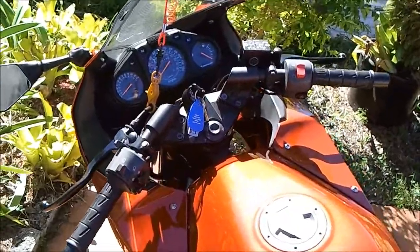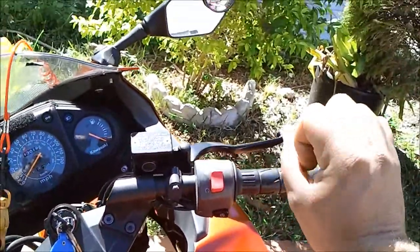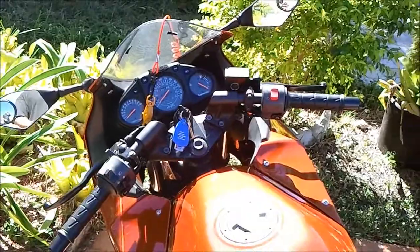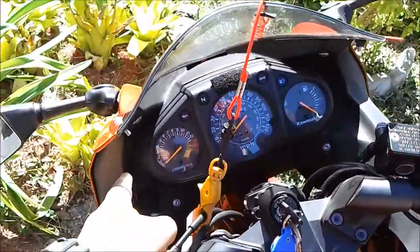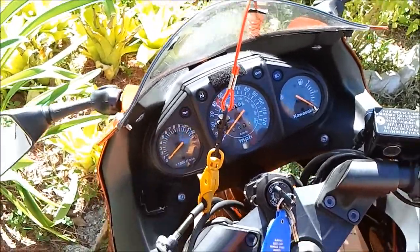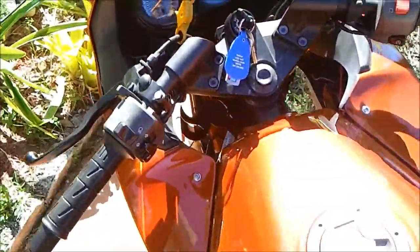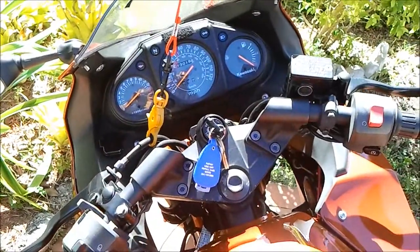The other day on the way to work, the bike turned off on me. I actually had to pull the throttle all the way back and hit the button to start it — not fun. On the highway doing about 50-60 miles per hour, the bike wanted to stay revved up to about 5,000 RPMs, then gradually slow down to about 2,000. If it dropped lower, it wanted to turn off. My choke right now is pretty much a secondary kill switch — it just turns the bike off.